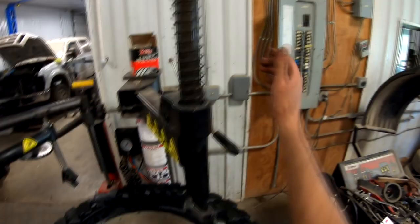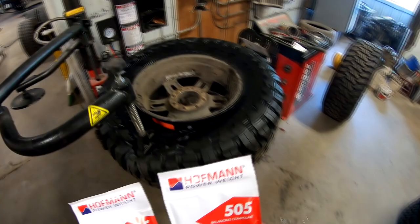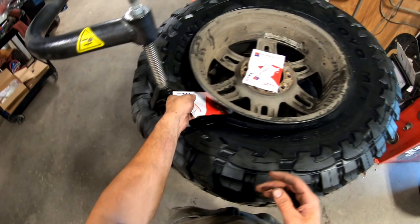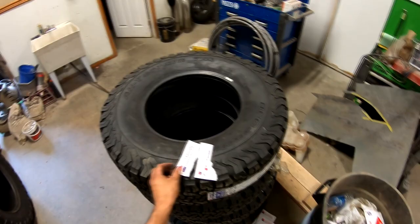I am balance beading this. Push down that far. I have been instructed that I need two bags of these — these are Hoffman power weights, six ounce bags. Dump it in. Make sure nothing's coming from underneath, but it should have already caught the bead. Do one more. Can't throw these away — there is a valve stem and a cap in there. Almost threw that away. And in with the next bag.